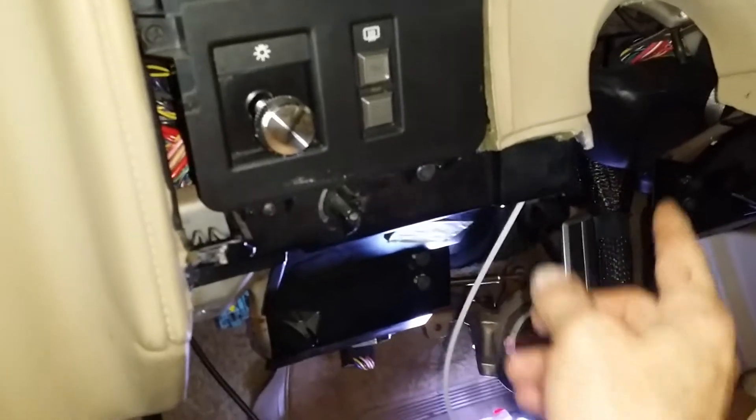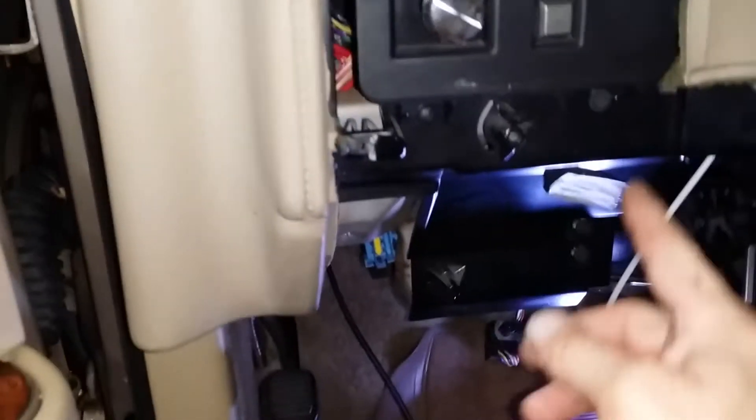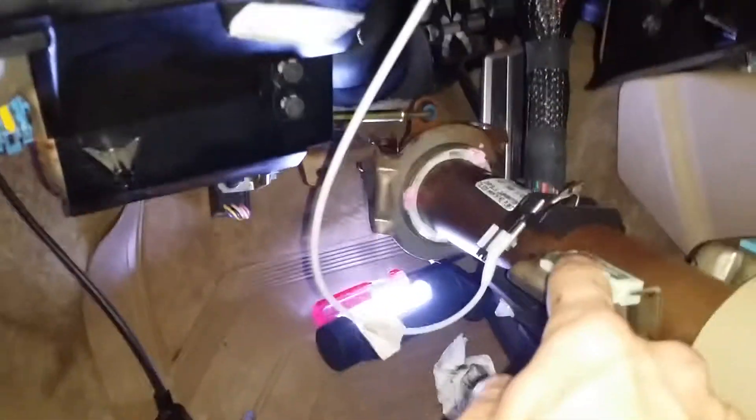As you can see, the steering column is dropped. In order to get all this mess out, there's a bunch of screws up under here. There are some screws across the top through here that need to be taken out, and a couple screws you get by going in between the two pieces. That's the mess of trim stuff that's been taken off. Ultimately it comes down to four bolts — one, two, three, four — for your steering column, and then it drops out.